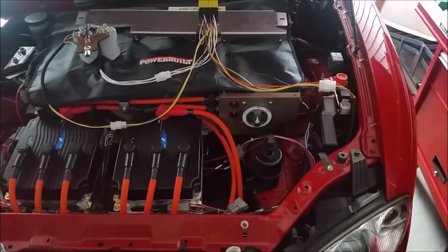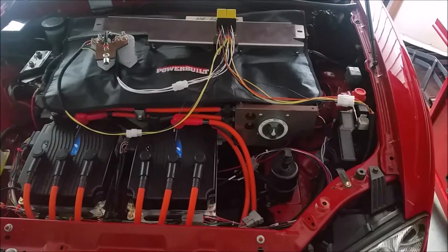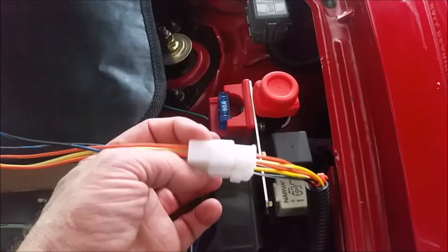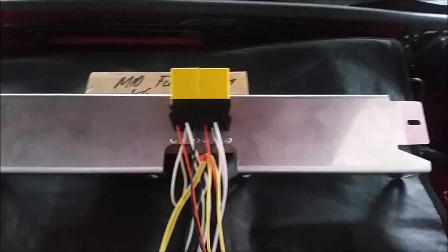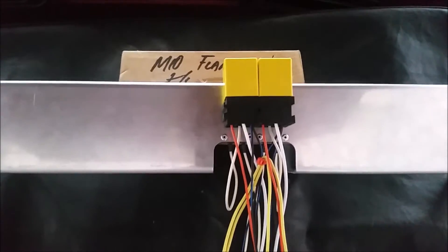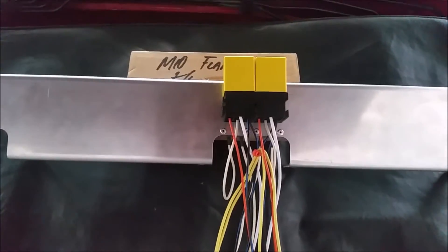It's taken me a little bit of time but I've wired up the pre-charge circuitry and the contactors for the motors. Here's what it's all looking like. Tracing through: we get the connectors from the controllers for the left and right — left controller on top, right controller on the bottom — and that goes up to a little block. I've got my high-voltage pre-charge relays; these are the special Tyco ones. I elected not to use the ones from HPVS just because I had these and felt they were a bit more appropriate.